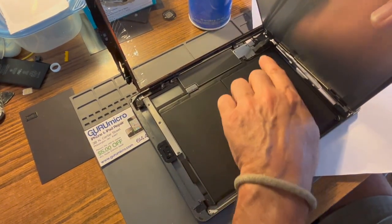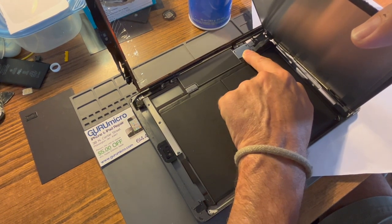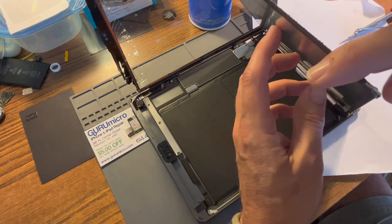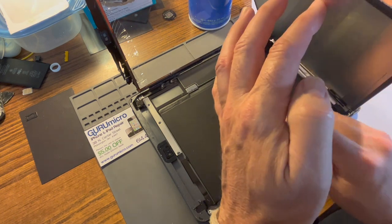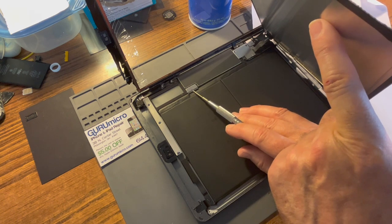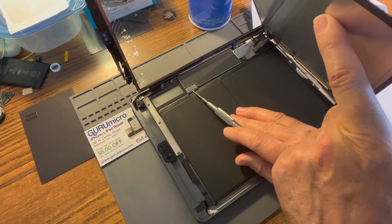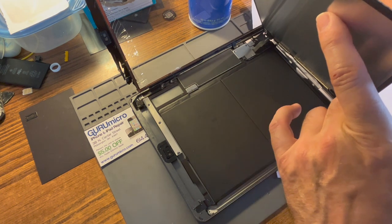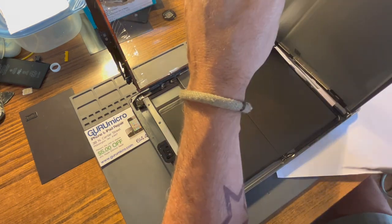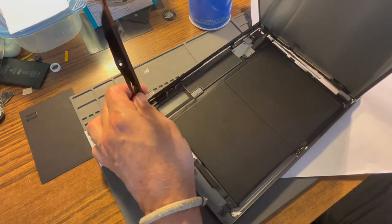Now that I've got this lifted, you can see right here we have a cable that comes from the LCD going to this plate. But before I do any removal of this plate, I'm going to take the screws out — but that's all I'm going to do because I want to loosen this board up. I want to take this screw right here out first before I unhook the LCD because this is the battery connector. It has one screw in it, and it's important whenever you work on these iPads that you put a battery block in, or you can actually cause the backlight inverter to short out.